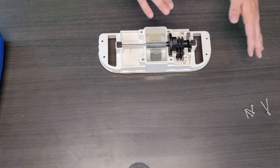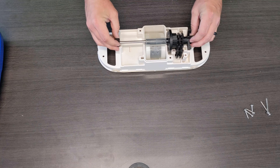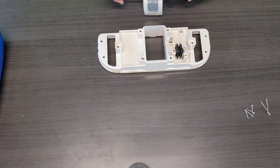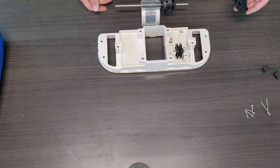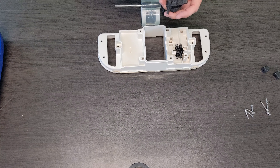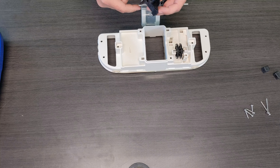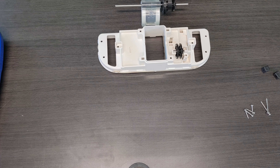If you want to know how to remove the entire part, check out the link in the description — we can show you guys how to get access to these axle blocks. But for today's video, as you can see, it just slides right up. These axle blocks come out really simply — slide off the side and then you have access to your cam. As you can see, it's got an A, B, and C, with C being the longest run, as you can tell by the spacing between the actual cams. As it's turning and hits a certain point, it makes the cleaner turn a different direction, with different time frames between each run so it has an opportunity to go down a certain direction before changing directions and heading back a different way.